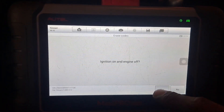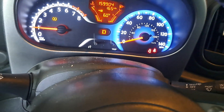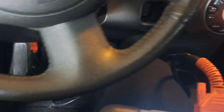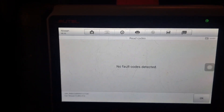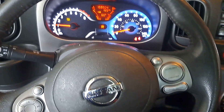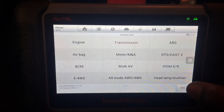I could clear them — let's see what happens. I got it jacked up. Yeah, still no throttle, I got the throttle to the floor. Let's just read the codes — there are no fault codes. Put it in reverse. Yeah, it went into limp mode. Let's see if there are any codes now — still no codes.